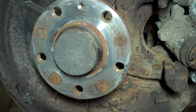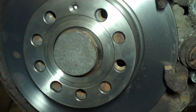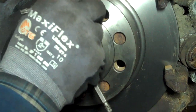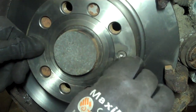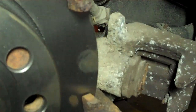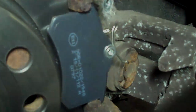I'm going to locate the hole at 12 o'clock here — there's a little hole in this one — and just hook it back in and get our screw in. We'll screw the little locating screw back in to get the disc seated. Then we'll fit our brake pads and use our wind-back tool to wind back the caliper piston — that'll be our next step. So we'll put our brake pads on this side and on the other side. Next step, we'll get our wind-back tool and wind back the piston on the brake caliper. Then we'll put our caliper back on again — slowly as we go.